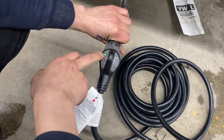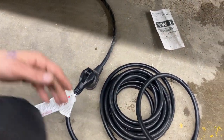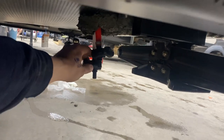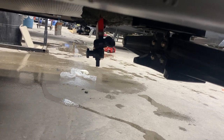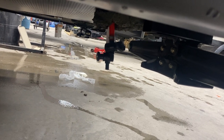At most campsites you can just plug straight in. Check those two lights: green means good power, red means there's an issue and you'll want your campsite to address that. Up here you've also got front drains — cold in the back and hot in the front. Open up that valve to allow the water system to drain itself. You'd do this if you're leaving the trailer for a while to keep water from going stale, or for winterizing before pumping antifreeze through.